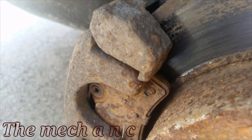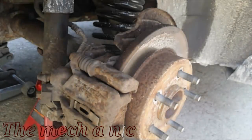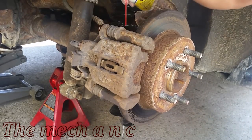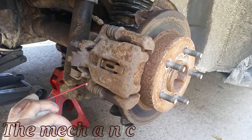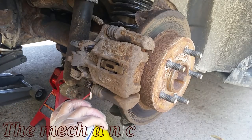Welcome back. We have a 1998 Ford Mustang and we're going to go ahead and get the rear brakes done. Normally if you look at your brake setup you're going to see that the rotor is nice and shiny, and that signifies that there's good contact between the brake pads and the rotor itself. But on this one you can see all the rust, so this tells me that there's something wrong with this caliper.